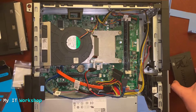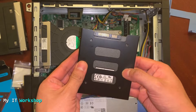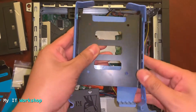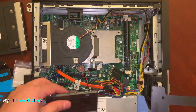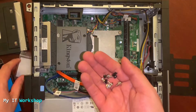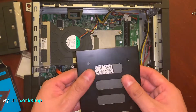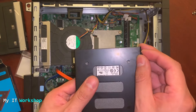Now I'm going to show you how it looks. You have to attach the SSD to this bracket. When you have the SSD attached to the bracket, you put it inside the enclosure — that's what we need for this model. Bigger computers like tower computers have these as well. We have two kinds of screws: the small ones to attach the SSD to the bracket, and the silver ones you can use in older tower computers. I'm going to attach it now using my Phillips screwdriver. The video is sped up so you don't have to wait through the whole process.